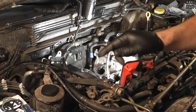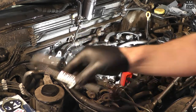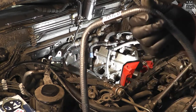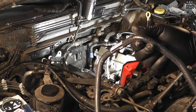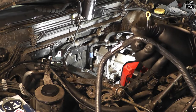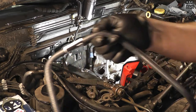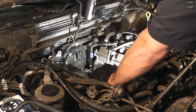I went down to my local O'Reilly's and I found some molded hose hanging on their wall. That will fix one side, and this is going to fix the hose we're working on now. It has many bends on it and I can get it close. As long as it isn't in the way of the intake and can reach the throttle body, I could care less. Let's get that hose off now, because once you put your intake down, getting to this is about almost impossible.